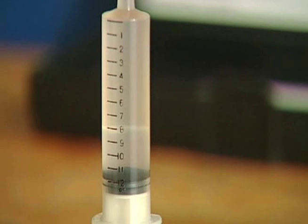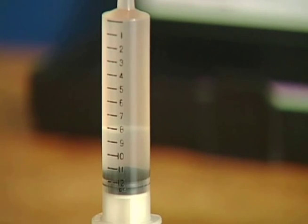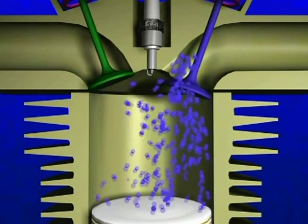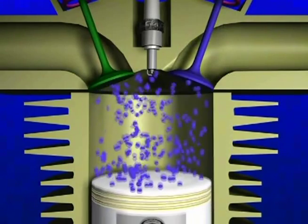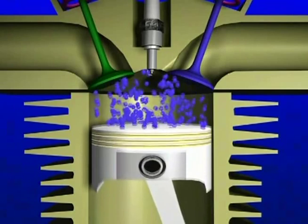after which ethanol and water will drop out of the gasoline. This is called phase separation. This ethanol and water mixture is heavier than the gasoline, so it settles to the bottom of the fuel tank where the fuel pickup is usually located. Of course your engine isn't going to run very well, and in most cases not at all on this mixture. Simply put, the engine can't burn water. And the remaining fuel in the tank doesn't contain ethanol, so if you purchased 87 octane fuel, you now have 85 octane fuel in the tank.